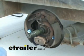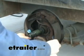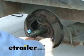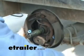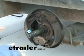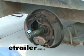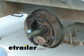Also make sure the shoes can float around pretty freely in here, because they'll have to expand a little bit with the magnets. If you can move them with your hands reasonably easily, you're okay. If it's real hard to do, chances are they've rusted together — you may want to take it apart a little bit and either clean it up or dab a very tiny bit of grease on the moving parts.